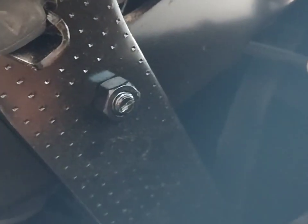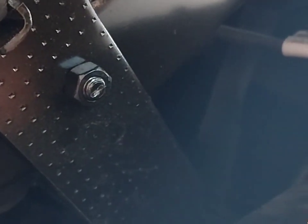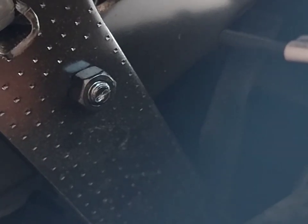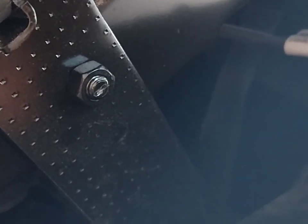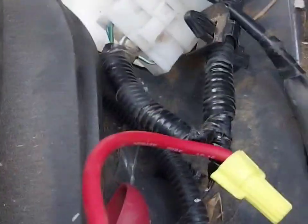Right now I'm going to run a new power wire from the compressor to the plug behind the seat, and I'm hoping that's going to fix the problem. I'll put everything back together and make sure the wire can't get crimped anywhere, which I think is what may have happened to this one. We're about to find out if my theory is correct — I'll be back.